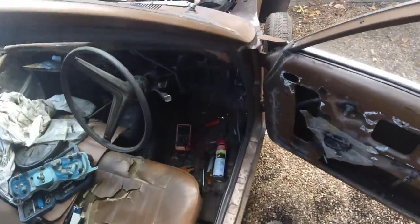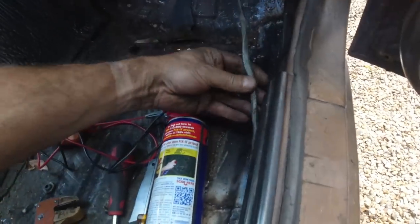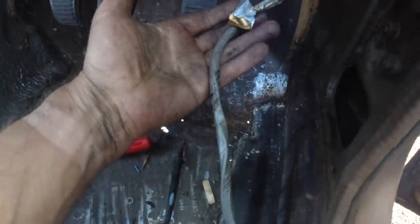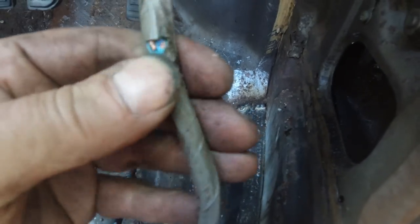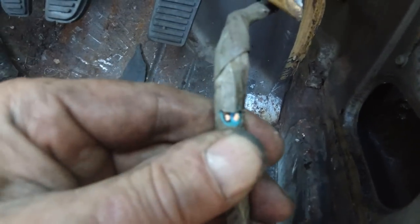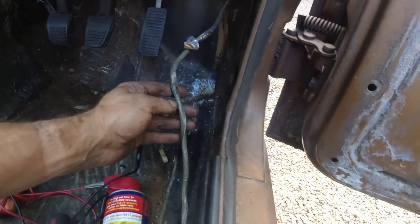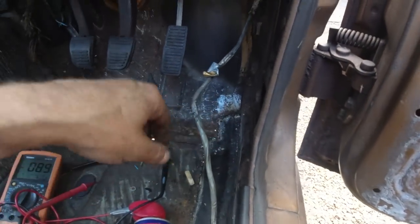So then I'm going to go further forward. So go to the next point, and we're just going to inspect the cable. There's something, there's a break in it somewhere. Keep going. Looks all right, doesn't it? Spin it round. And what's Pete done? He's angle ground through the lead, look. So it's my fault. Look what we've done. And that's why the fuel gauge isn't working. So I'll just solder that back up and we're good.